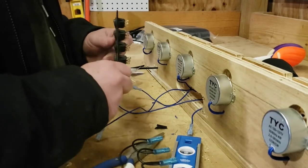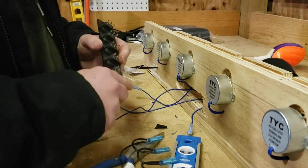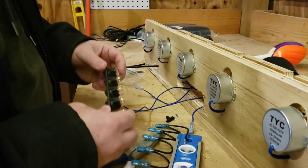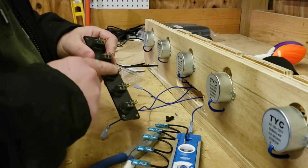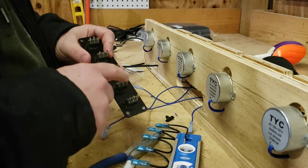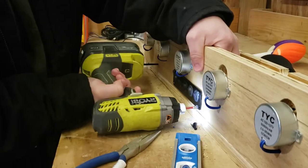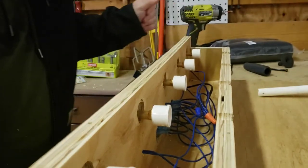We are going to use the top pins as accessory and the center pin as power, reverse from how we had it before. All right, so I have that backwards. Actually, what we're going to do is power is going to go to the top pin and accessory is going to go to the center pin. We should be in business here. Let's see if that's true.